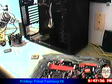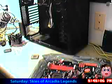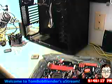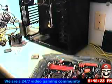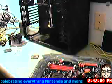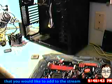It says, before installing the CPU, make sure to turn off the computer and unplug the power cord. Okay. Check the pin 1 marking triangle with the pin 1 corner of the CPU socket. Align the CPU notches with the socket alignment keys and gently put the CPU onto the socket. Okay, it doesn't show you where that is. Yes, diagrams are key. Yeah, there isn't a 1 anywhere on the chip. Dual laser says, jam it in there with a hammer.